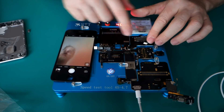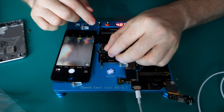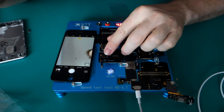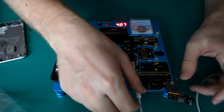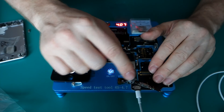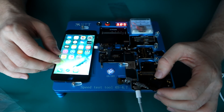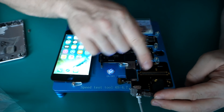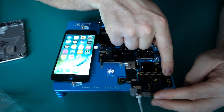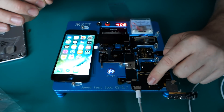So that's the rear camera, and let's see if we can switch around — yes, both cameras are working! Here's the other camera right over there, and you can see me upside down. The lightning jack is down here and the headphone jack is here — it's charging here, so that works. I don't have any taptic engines, but the taptic engine actually sits on these two connectors here. I think these are the taptic engine connections that you can use for testing, and then this is actually where you can test headphone jack connectors.